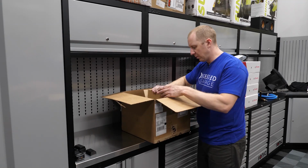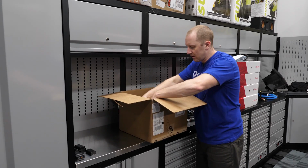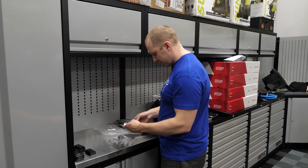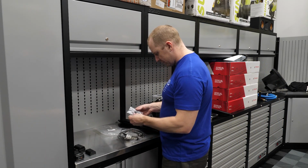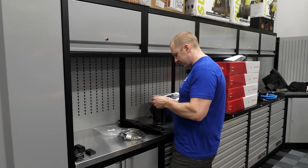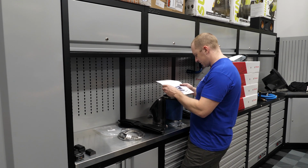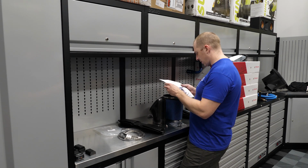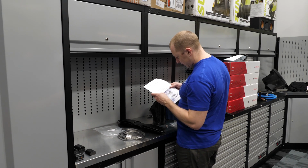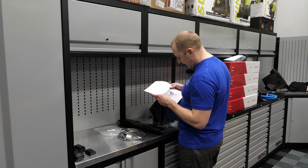And then we'll put all the factory stuff back in the box here, so I'll have it if I need it. Okay, so here's all the gear. We do need to replace a bolt with, I think, this screw. So we already did this, A, B, C. Probably need to put the air box back in, remove the stock intake, release with T25 Torx head, disconnect the flexible hose. So we did all that.